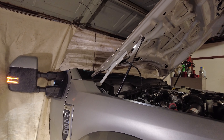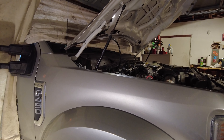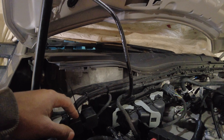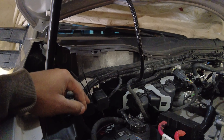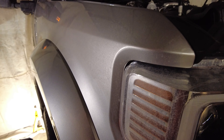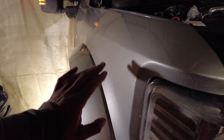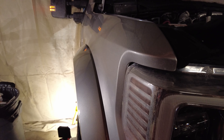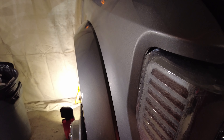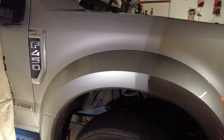If it does come back I'll have to fix that wire, but small pinholes should be fine. In hindsight, if I were able to just come in here and check this relay with a jump wire to rule that out and understand that the module is not working, that would have been ideal. There is a silver lining — I was able to make an adjustment to my fender flare, which had a little gap from a broken plastic tab last time. Now that gap is no more and it looks perfect. I've also gotten quicker at removing the wheel liner.